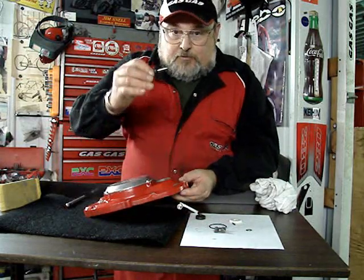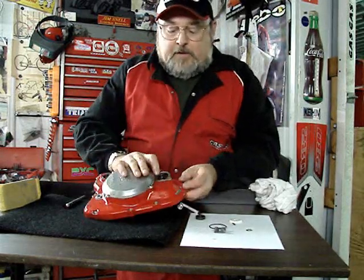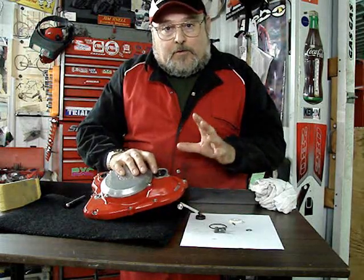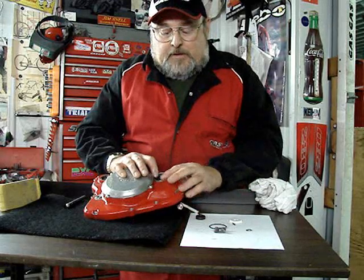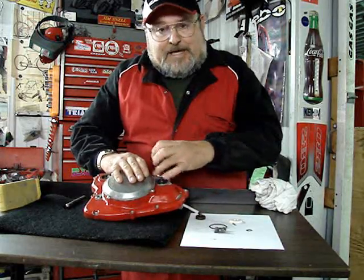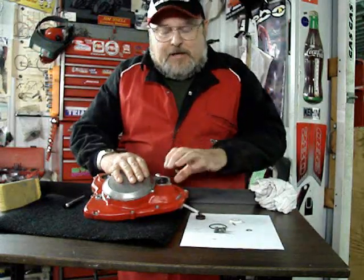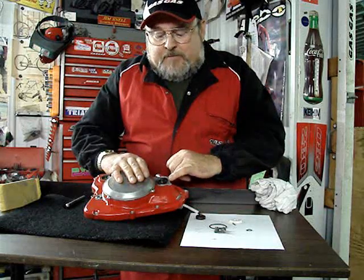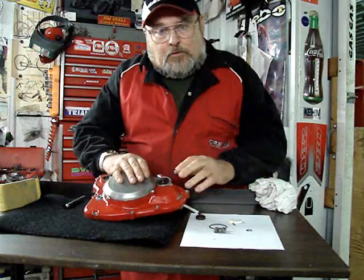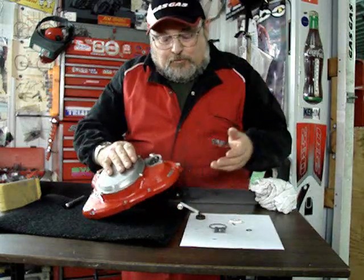The shaft seal and clip is inserted into the cover from the outside. Lubricate the exterior of the seal also with silicone grease and everything must be very clean. When removing these seals, it's easy to damage the case by prying, so it's best to heat this area with a hair dryer or heat gun. Then when you very carefully pry out the seal, it should release okay. If you have problems, take a small piece of wood and use it as a buffer between your pry tool. Always be careful with your tools so you don't impale yourself with a screwdriver.